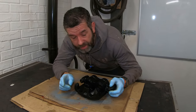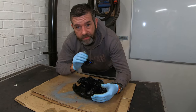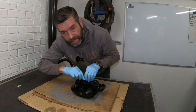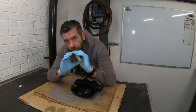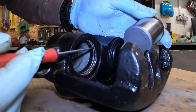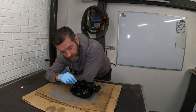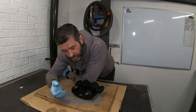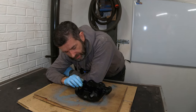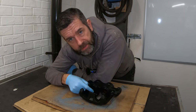I mentioned I had two issues with my calipers. We've discovered the first — the slider seizing up — but also the piston can seize up inside the caliper. Where the rubber gaiter sits inside the caliper, it is seated within a round ring. That round ring on the entrance of the bore seems to build up corrosion over time, and as it does, it clamps down on that gaiter onto the piston. Over time as corrosion builds up it clamps that piston into position so it's not free-floating in and out of the caliper. You may come across that issue once you strip your caliper down — just a case of cleaning up the corrosion around the entrance of that bore hole.